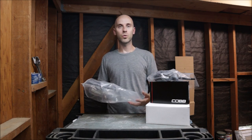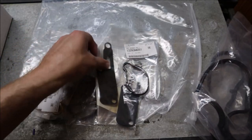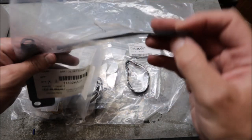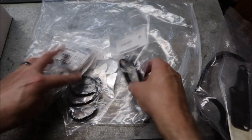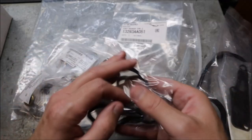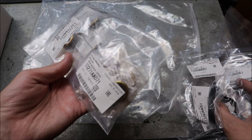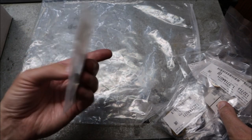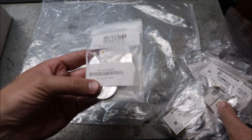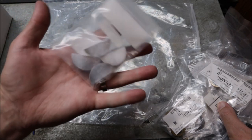This is going to hopefully reseal the oil leak. We have rocker cover gaskets — valve cover gaskets, left and right. We also have a couple of super thick rubber gaskets for the oil separator, one on each side of the valve cover — there are four of these. They are for the spark plug holes, and a dozen or so of the spark plug bolt hole gaskets. Every bolt that holds the valve cover to the head has a gasket. The only actually fun thing about this whole project will be the half moon billet covers. The ones I have now are plastic — they might be the culprit. Some people have said to change those out; they get brittle and break, and these should outlast the car.